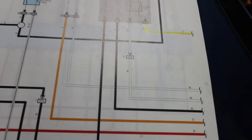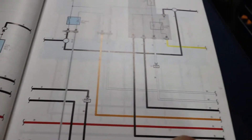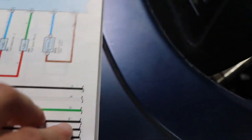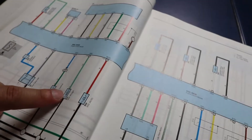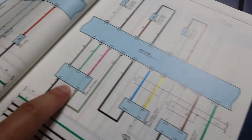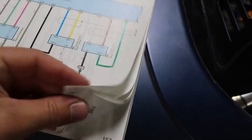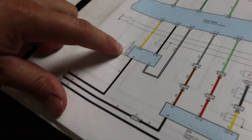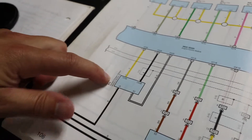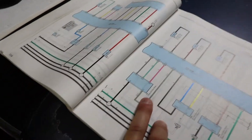That tells me right there that wire was basically a pass-through, getting power off the 10-amp EFI fuse which is in there. So I'll need that fuse in my replacement box. It's going all the way across this page feeding the VSV — gone, VSV purge — gone, VSV ACIS — gone, and mass airflow — so we actually care about that one. We do need to keep that circuit in play, just the power to the mass airflow. But wait, there's more — it continues to the next page: heated oxygen sensors bank 2, downstream sensors — they're gone too. So the only thing that wire is going to be doing in my car is the mass airflow, so I'll keep it.